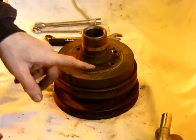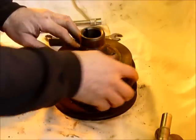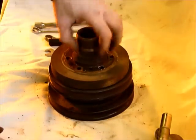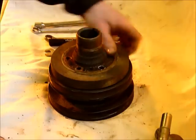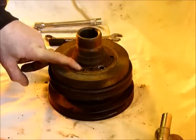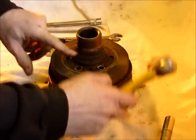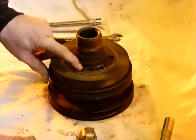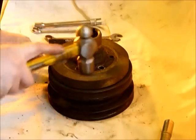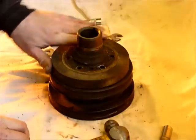What you have around here is many years worth of debris. It is worth cleaning this off with a wire brush just in case the trigger wheel doesn't fit — this one isn't too bad. There is also a little dowel poking up which actually locates all of the pulleys in the correct position. Whilst you don't want to lose it, you certainly don't want it poking up, so make sure it is now flush with the bottom.